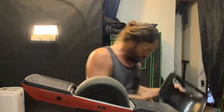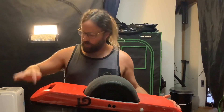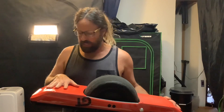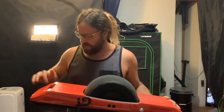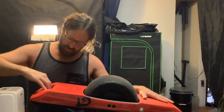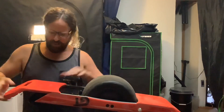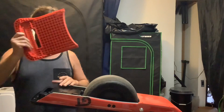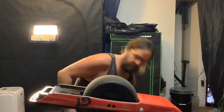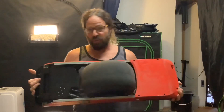After removing your fender delete or fender, the next thing you want to do is remove the four screws on the front bumper. I've already taken those out. You want to grab it right here — they recommend not grabbing near the overlap of the other plastic. Just grab it from the right spot and it slides out very easily.